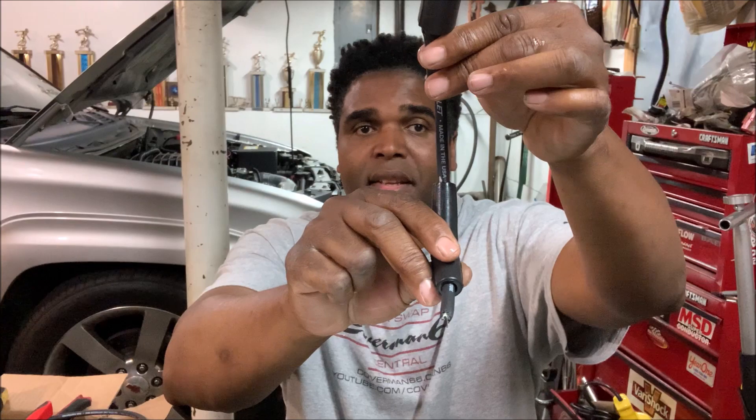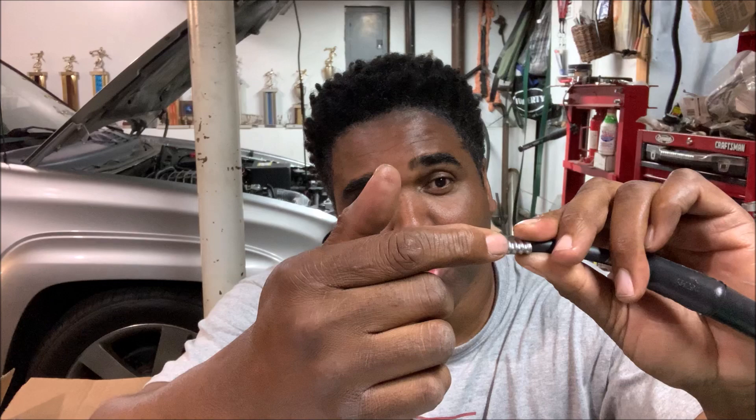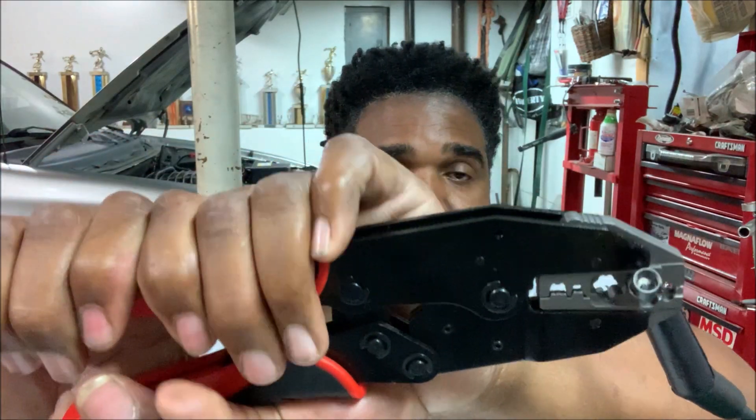You don't want to put the wire into the coil and then have to twist the boot all around. So I want that nice clean look where it just pops in straight without having to be twisted, wires all bent and messed up. Fold the spiral core back, push the terminal onto the sleeve — you want that spiral core to make connection with the terminal — then get the ratchet crimping tool and as it tightens, that 'm' is going to bend the tabs inward and crimp it.